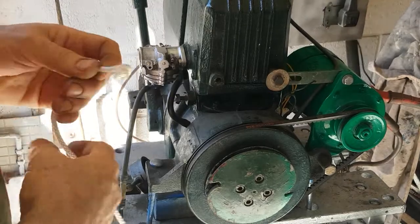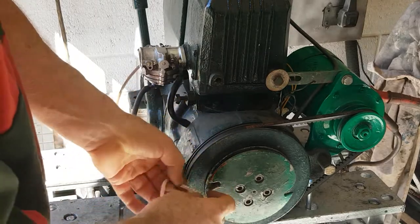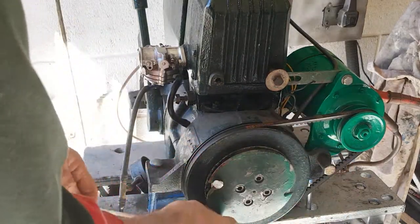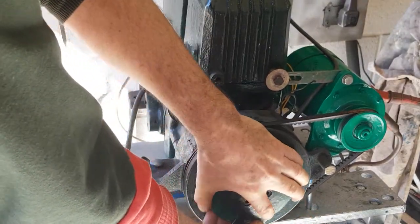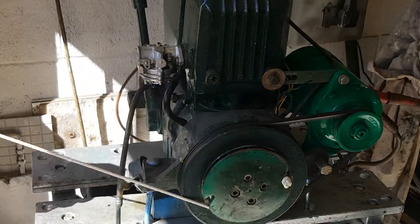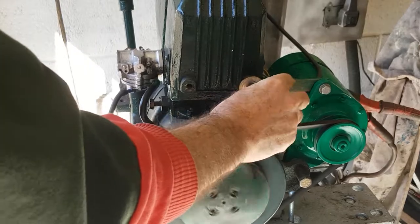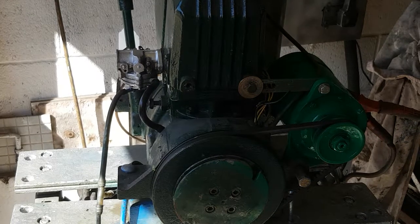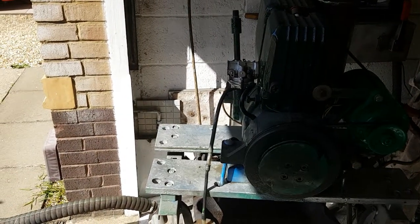This engine is warm. I'll show you how to prepare a cold one in a minute, but basically put your knot facing forwards, go round a couple of times, and then turn the crank so it's just past the tight point — then it should be easy enough to pull start. I'll show you that again, and I'll widen out so you can see what I'm doing in terms of effort.